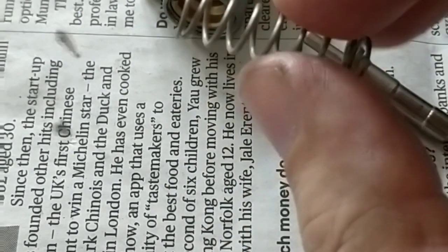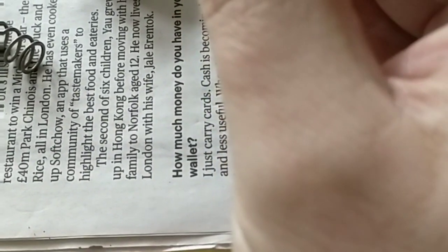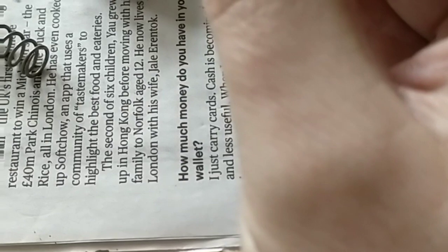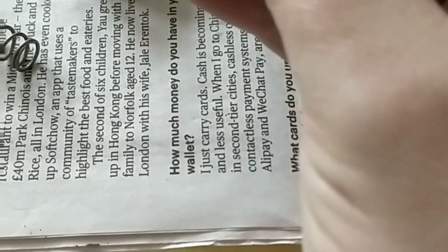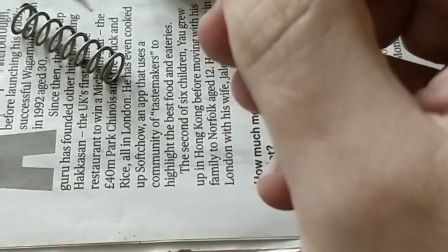Well, one of the things that I think could potentially be done is to put a weaker spring in. The weaker spring should allow the strike to be harder and less resistance against the valve. With luck, what that will then do is create more gas through the valve, and therefore more gas behind the pellet. That could certainly be one way of doing it, which I will try.